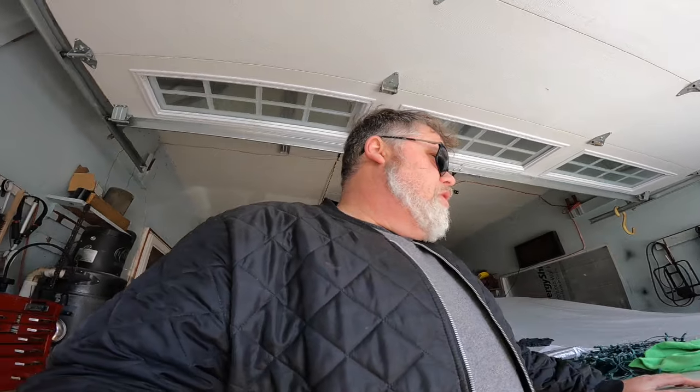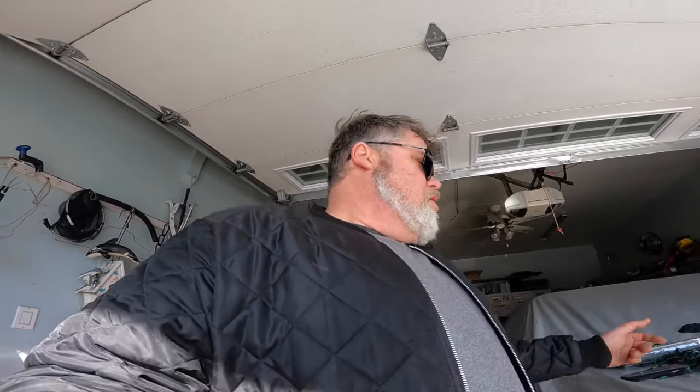Today on the BillSiff Show, we have ourselves a Chevy Cruze with a door regulator issue. Now, if you have any idea what I'm talking about, all these door regulators in these new vehicles run off a cable, and they're all junk. They don't last very long, or they get frozen, and then you go to roll them down, it pops the cable out of alignment, and then it chews it up.